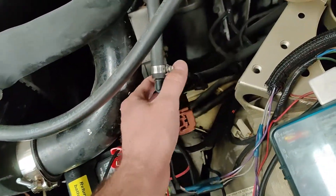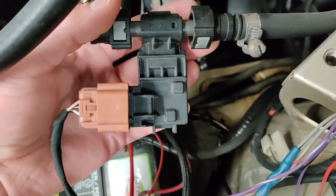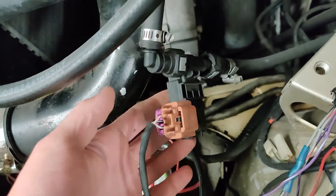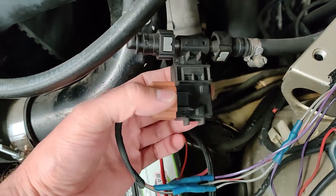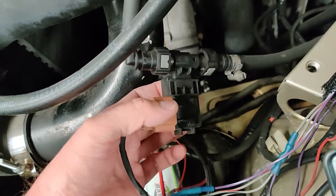What I have on my car is a flex fuel sensor — the typical one you see on GMs. It's a Continental sensor, 50 to 150 Hertz for zero to 100% ethanol.